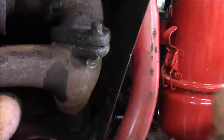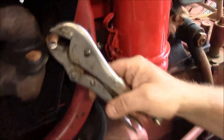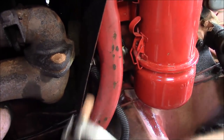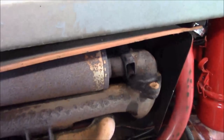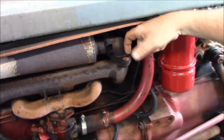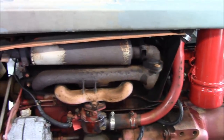That's going to be hot — like your best friend's mom in high school. You can see the nut wasn't going to come off there; you see all that was in between. Now Brett's managed to get all the rest of the exhaust loose with a little help from the Knocker Loose. This is obviously brazed on here, so the next order of operations is probably going to be to cut this pipe and then see if we can force this around and pivot this joint so we can get in here and cut this out — there's nothing here worth salvaging.